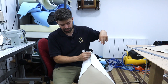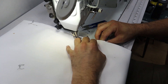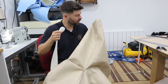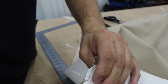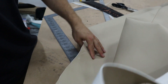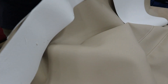Now we're going to sew the side panel on, following it all the way around using the nips as guides. I start where the nip lines up with the seam. I've stitched on half of the chair now. For the other side, I couldn't get everything to line up exactly, so I used a stapler to hold it in place temporarily — staple it in place not too far in, to allow the half inch sewing to go over the top. The most important bit is getting the nip to line up on the top — that's the best way to do it.